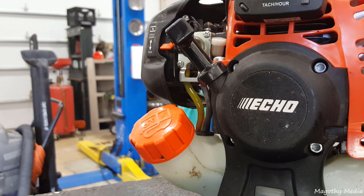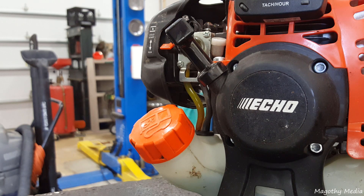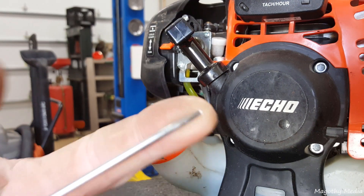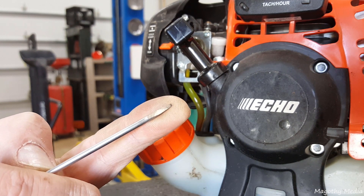Alright, so hopefully you can see it's just not running optimally. Now I've had success getting these plugs out with a Torx T9. If that doesn't bite it, sometimes a T10 — the T10 is right on the edge of being too large. It actually has a little lip around the outside and a little well in there, and all you're grabbing is that lip, and it's a threaded plug. This one is actually stripped out, and I'm going to be just using a ground-down straight screwdriver here.